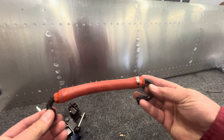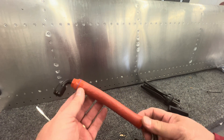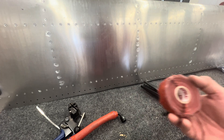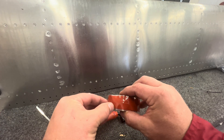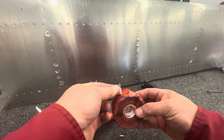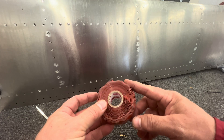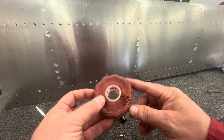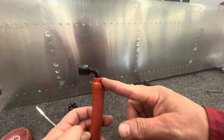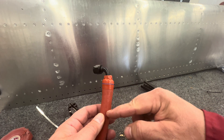I have prepped my fuel hose with silicone high-temperature fusion tape. It comes in a roll like this — you cut a section and peel off the plastic. This tape only sticks to itself. I stretch it pretty tight to get a nice seal around here, and that just keeps anything from fraying or getting down into the white insulation part of the heat shield.